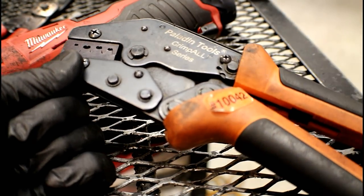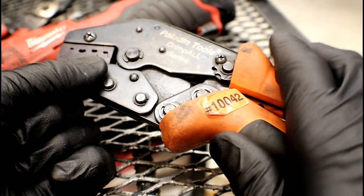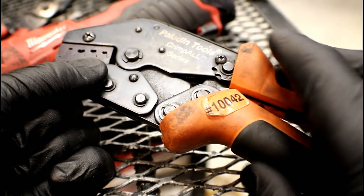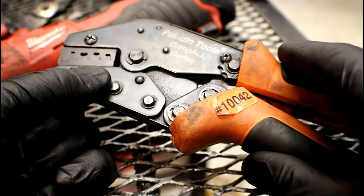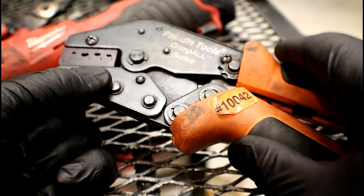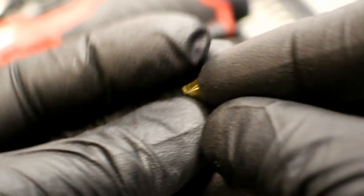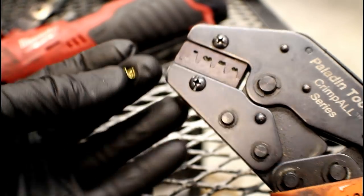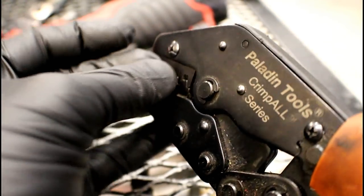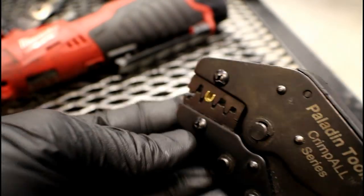One of the tools I like to use whenever I'm doing wiring repairs is a crimping tool. We're going to be crimping a sleeve over the wires and not using a butt connector — please, whatever you do, do not use butt connectors on these repairs. They're not weatherproof, and they still don't make the connection that you need. Instead I'm going to be using something else. The brass pieces we use are kind of U-shaped — the two wires get inserted on both sides and the tool squeezes it tight. The brass crimp gets inserted into one of the corresponding matching-sized holes on the front of the tool; squeeze down gently just to hold it in place, then insert a wire on each side.